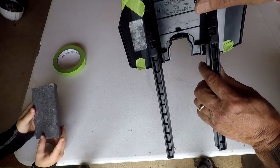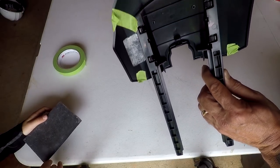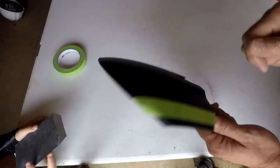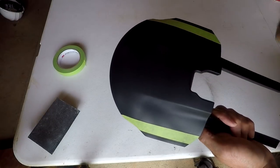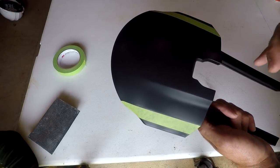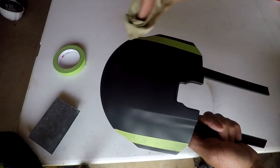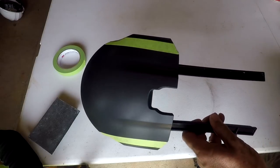Wrap your corners with the paint so you do not leave an edge right here where it can get picked at — an edge could get picked up and chipped off. And with primer, do not go over an hour. You can go over an hour if you're continuously painting, but the last coat — whatever you're putting on — if that goes dry for more than an hour, you've got to wait over 48 hours or else you'll get orange peel. It has something to do with the chemicals in the paint.